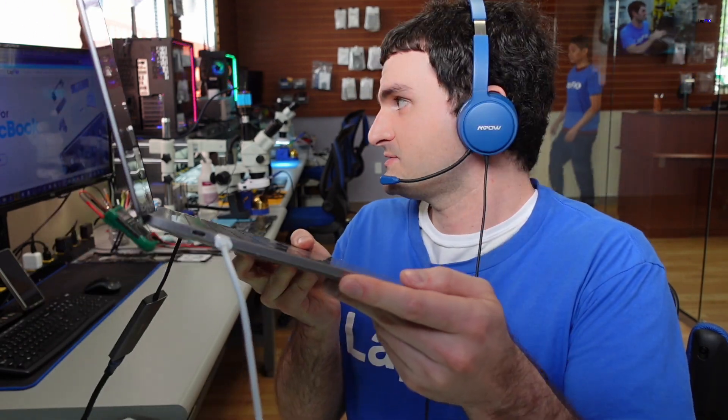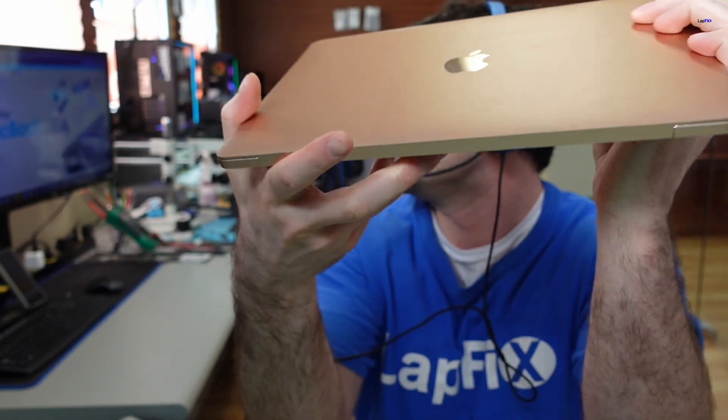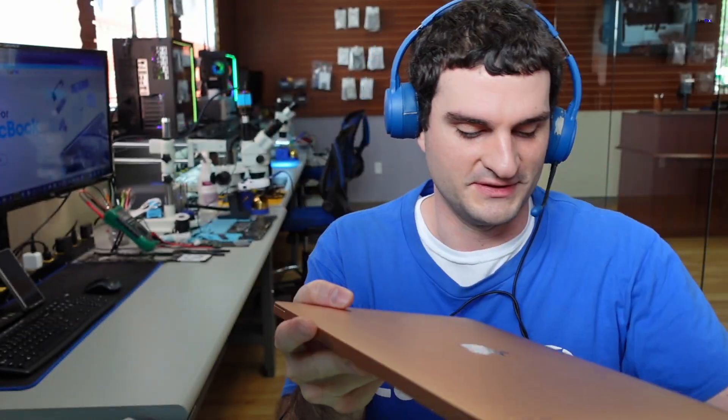Now we're also going to be connecting our patient MacBook. So I have this one into our bottom port, which is the master port for mine. We have it plugged in down here, and now I'm also going to plug it into the patient MacBook — this one only has a few ports so you can't really mess it up. It only has two ports anyway, but the one closer to the trackpad is going to be the bottom one. Now I want to keep the Apple Configurator open. You might get something in the corner about a Thunderbolt accessory not being available or not being able to be connected. This MacBook is at least recognizing that something's plugged into the port, which is at least a good thing. If you have any corrosion or liquid damage, this probably isn't going to work — you need to fix that first.